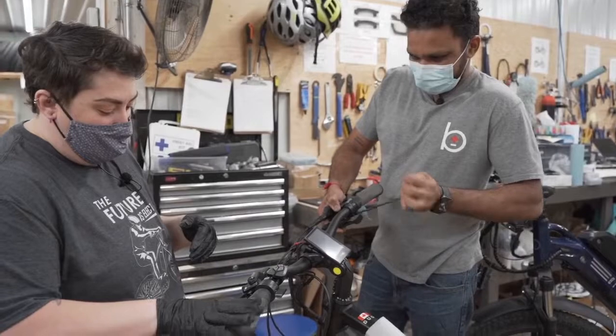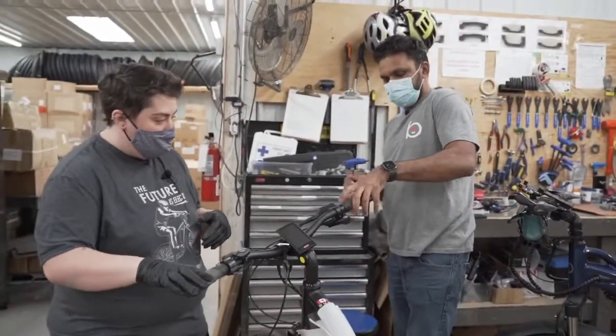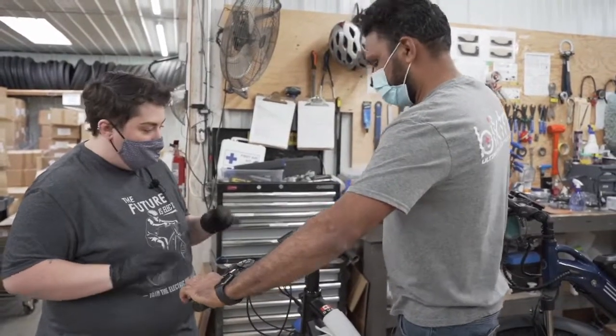We have this little pot — it has plastic threads so you can screw it in, but be a little careful otherwise they'll easily strip. You can find these setups on Amazon or at a local bike shop — sometimes called a bleed kit or burp kit. Tektro bleed kits are very common, and for the Bike Tricks brakes, Shimano bleed kits are also compatible. Now we've got some red mineral oil — not Kool-Aid. If you see closely, you can see the air bubbles coming out. You literally just squeeze it until the bubbles stop. The mineral oil goes in and replaces the air, your brakes firm up. Next, suck the oil back and use a napkin so it stays clean, not forgetting the O-ring. That's it — brake burped!